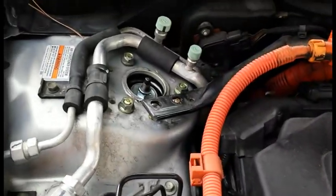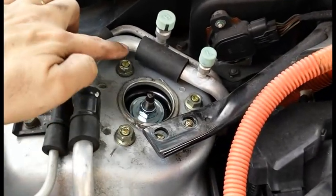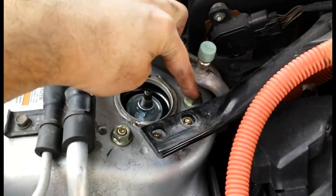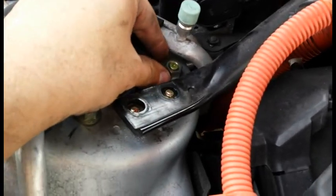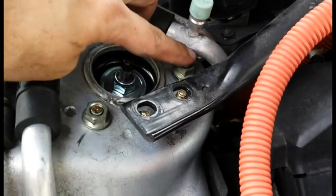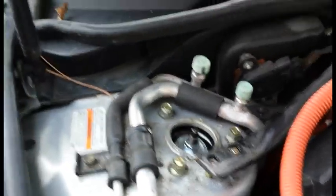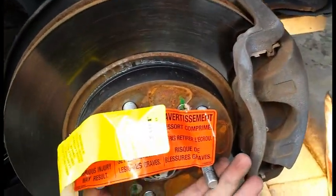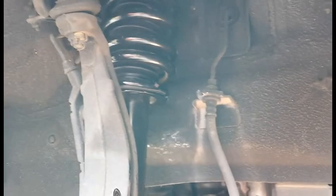After a little bit of finagling, the strut assembly is back in there. I put the three nuts back on but only loosely. A good rule of thumb is get the top of the nut even with the top of the bolt and you've got enough threading on there to be safe. I had to move the hub section up and down while rotating the strut and working it left, right, and every kind of direction just to get it through there. It's a little bit of a pain but definitely doable with a little bit of muscle.